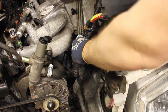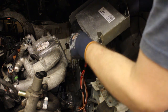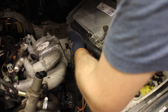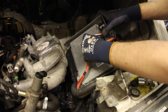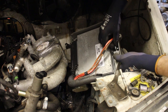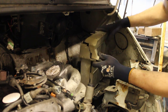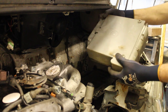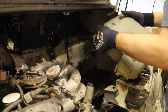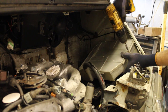The first component to fit is the ECU, and this connects with a large multi-pin connector. The casing also houses two relays which need plugging in as well. With that done, the front half can be installed. It's best to take your time here, as there are several overlapping tabs which are easy to misalign if you're not careful. It can be quite a faff to get it all in line and fitting properly, but if you go carefully, it's not too bad. And it's held on with a single Torx screw.